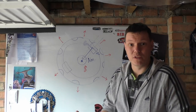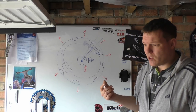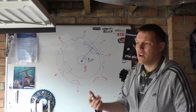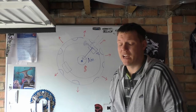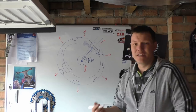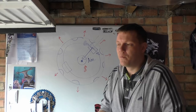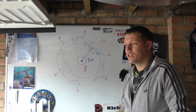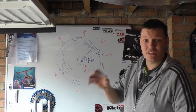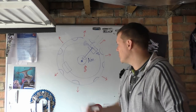This heat dissipation is one of the really good reasons, the torque, but the expense of it also means that you have to design your wheel to incorporate that, instead of normal bikes where you can just switch wheels for different wheels as long as you can get the right spacing and stuff. With this, this is directly mounted to the wheel. And with other bikes, if you want to swap wheels, as long as everything lines up, you're all good to go. And as long as the whole pattern is the same, you can even change the disc size, and even then you can try and fudge around if you wanted to.